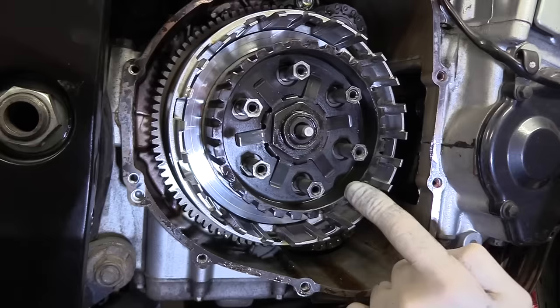Okay, now make sure that when you put them in, every single one slips into place neatly. There's no resistance or force. Don't force anyone in. Make sure they all rattle in nice and gently up against each other. And a little squeeze and they'll ring out. Basically, squeezing them together will ring out the excess oil. And then there's just the final friction plate.